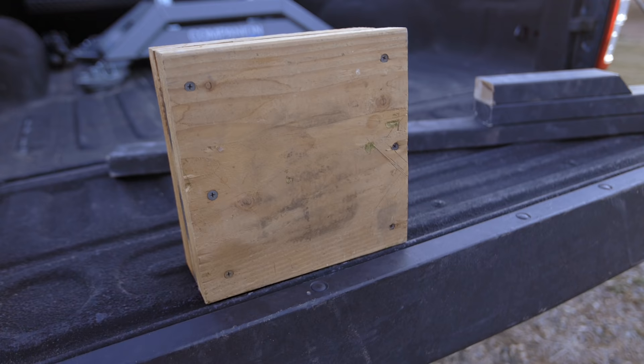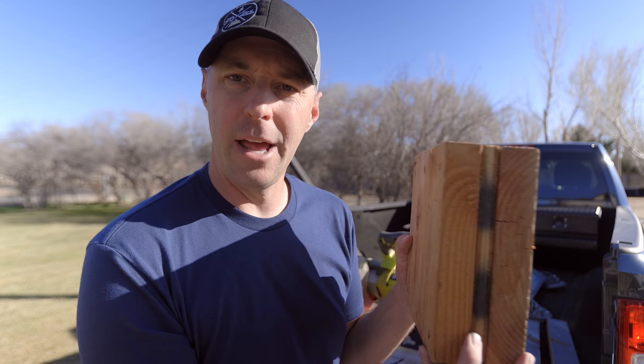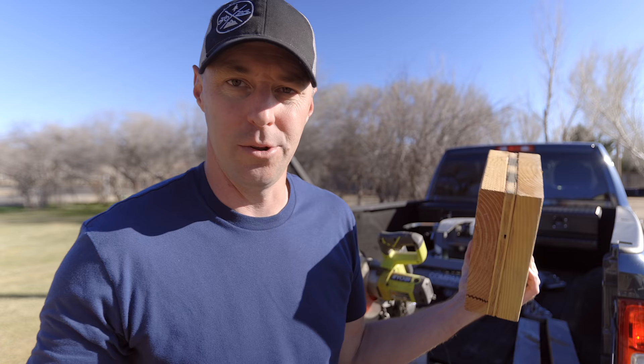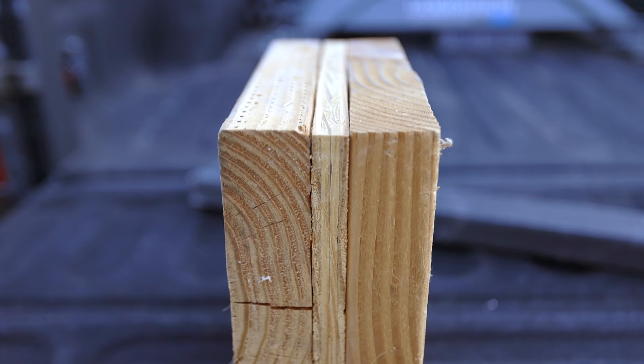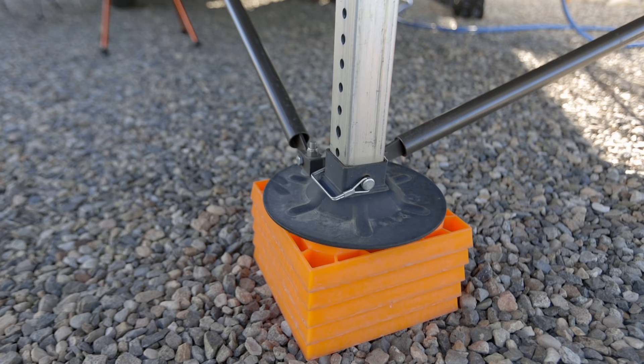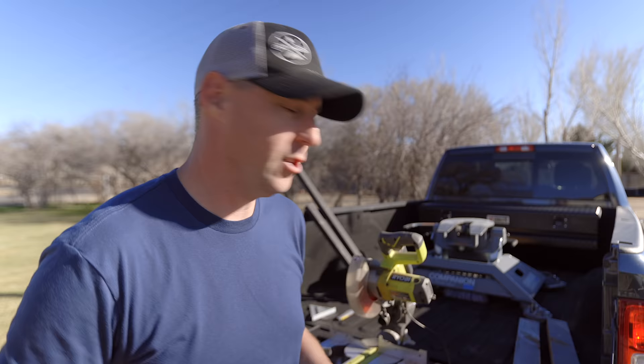The next one is building pads to go underneath the stabilizers or leveling jacks on your RV. These are simple and have been around a long time. Rather than just cutting a piece of wood to size, I put a piece of plywood sandwiched in the middle between two pieces of two-by lumber. The two-bys like to split and plywood likes to delaminate in the rain, so sandwiching them together helps keep them from splitting so you don't go through wood blocks all the time. We still like to use stackable blocks on our RV because we can vary the heights at different points, but this is a cheap easy solution.